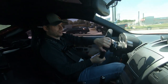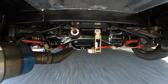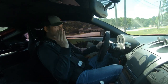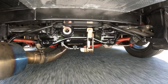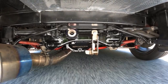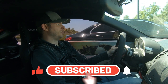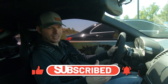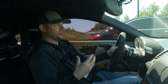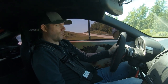It was definitely time to address the issue. I installed the rear subframe bushing collars on the Q50 and noticed a massive difference, so I expect nothing short of that in this car as well. The difference with this watch before you buy video is that I'm giving you real-time feedback as I'm testing this product out — this is the maiden voyage for the car after installing these collars. We're listening for weird noises to make sure everything was installed correctly, because when you add anything that adds rigidity to your subframe or driveline, there's potential for NVH — noise, vibration, and harshness.